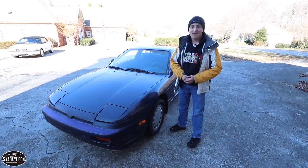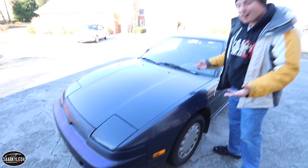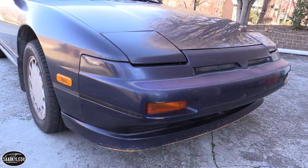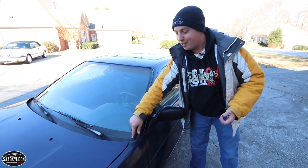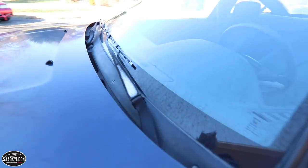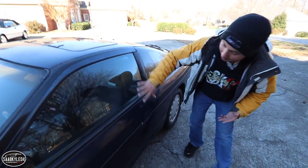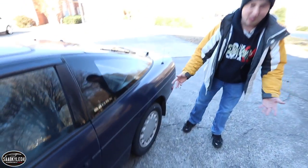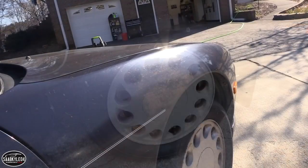So Kyle, tell me the areas you want to focus on for cleaning this 240. Because this car has been sitting outside for as long as it has, the paint is pretty faded. There's a lot of spots — you can see where dirt's been collecting, there's a lot of mildew. So I think a good compound or a polish and wax would do really nice just to liven it up, and it's gonna come out looking nice, especially for a 27-year-old car. There's actually moss growing in the windshield cowl. The glass also has a ton of water spots — you can see the etching top, bottom, left and right. Everything needs to be cleaned up, and that's gonna improve visibility a lot, especially at night. Across the sides you can see a lot more of the water spots, and that's where the polish and wax is really gonna come in handy. Down below, we obviously want to focus on the wheels. These are the original 15-inch wheels, very much intact — no paint fading or peeling — so I think those are gonna come out really nice.